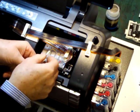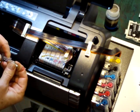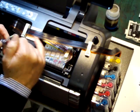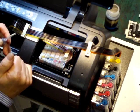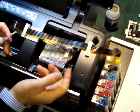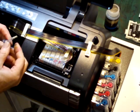Now it may be — let's release this off again — it may be that you've actually got a little bit of ink dried up in the line. It's very rare but it can happen. I've seen it a few times in my experience, but it's quite rare.